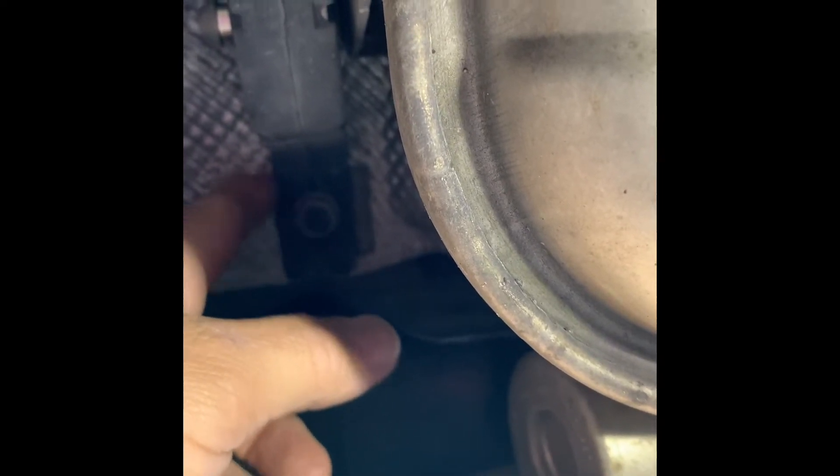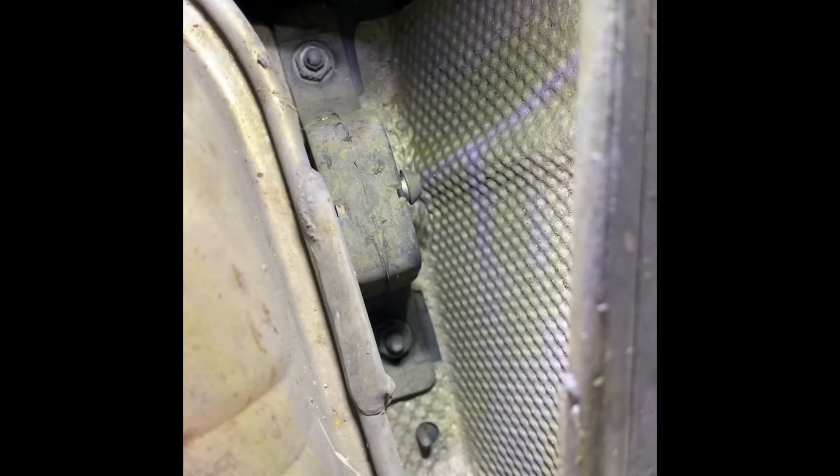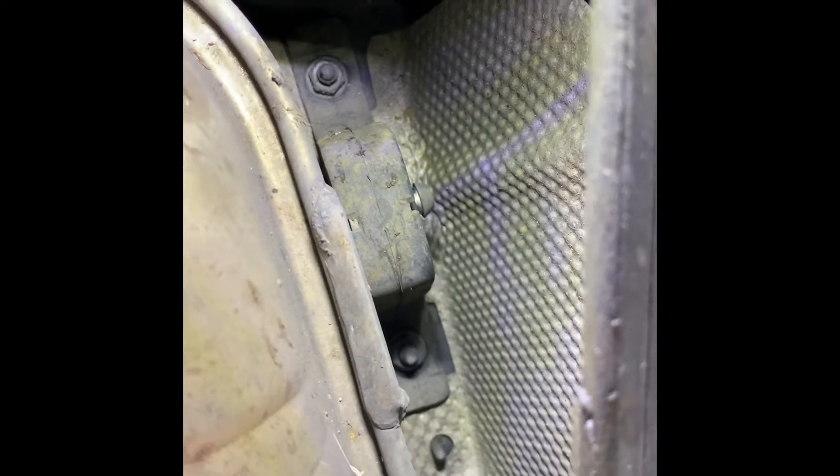At the rear, here's one of the isolators that holds up the muffler. On the passenger side towards the rear of the muffler, there's a stud with a nut — I use a deep socket for these, they're 13 millimeter also. There's one on each side of the muffler. What I usually do is get everything loose, take those center brackets out, leave at least one nut on here and one at the front exhaust manifold, and then with two people you can finally take your last nuts off and just drop it down nice and easy.